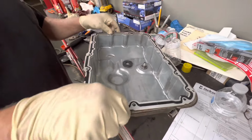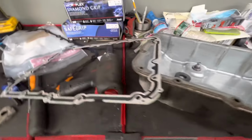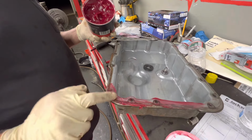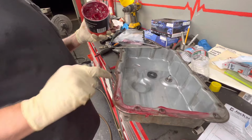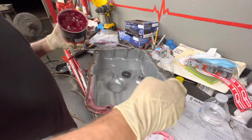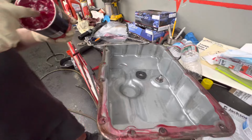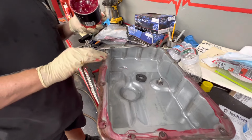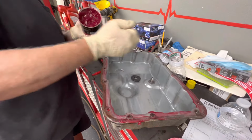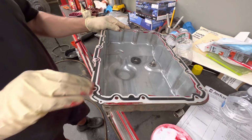Let me get some grease and put it on here and we'll throw this thing together. We like to put a thin coat on so that when we torque the gasket down, we'll see a little grease come out the side. We know it's evenly tightened. This stuff will basically wash away. That's Steve's little trick to know that he's torqued right, sticking my gaskets on. Okay, we got the holes lined up. We'll do the same thing on the top of this gasket.